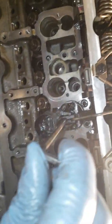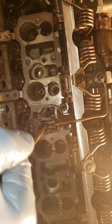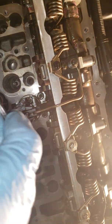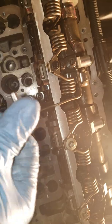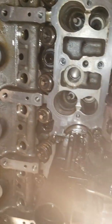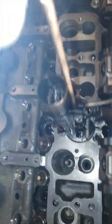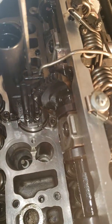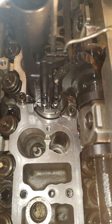What we've done is drill the hole through the valve cover to drop this allen key through so we can manually rotate the eccentric shaft to max lift. We're going to go in a clockwise fashion. This is spring loaded — all you're doing is preloading the valve springs. As I rotate this allen key clockwise and move toward max lift, you can see the gear coming up higher and higher. This happens in milliseconds when the car is operating.